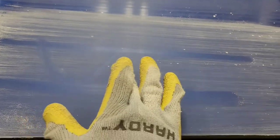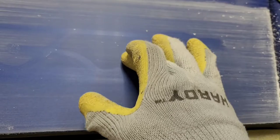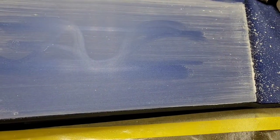But what I do is put on that light dust coat at first, and then I put my layers on, each one after encapsulating. Let's say you got a silicone particle right here. My first layer is going to go over that, and I'm going to let it flash to where it's not liquid, it's not wet, because if you shoot on that wet, then that silicone particle is going to actually repel the clear with each layer that you put on. So when you do the next layer, if you don't do it right, then it'll dip down to that fisheye, and then each new layer you put in, it dips down all the way until you end up with a great big hole.